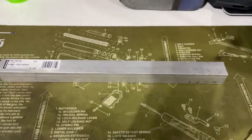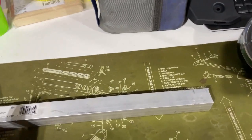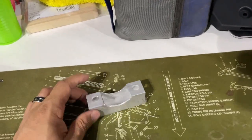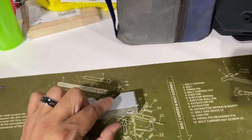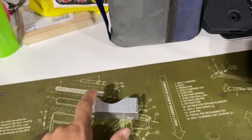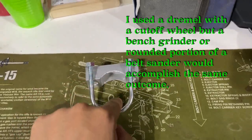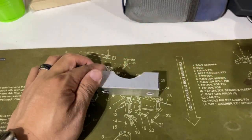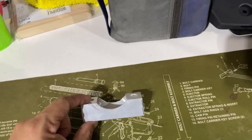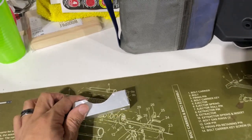Now we're ready to move on to building the bracket. Take your one-inch piece of aluminum square stock and cut three and a quarter inches off of that. I went ahead and got this bracket already made, so I'll give you the dimensions. I cut three and a quarter inches, marked the center, then measured from one side to the other off the center. We have to notch this out because it's going to sit directly on the steering column — that's what gives it stability when you run the u-bolt clamp through. The notch from one side to the other is right at about an inch and a half, and notched down to half an inch deep to give you the half-circular dimension — cut it out on both sides so it's even.